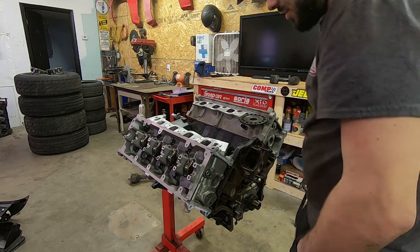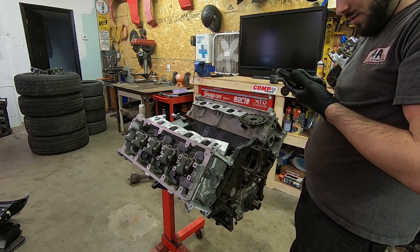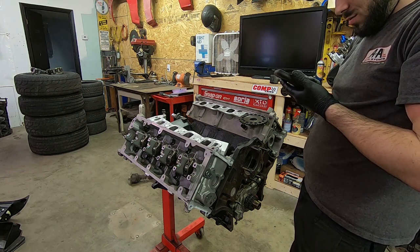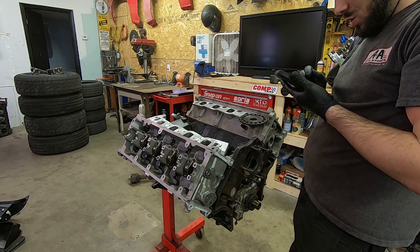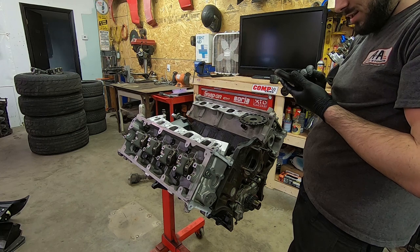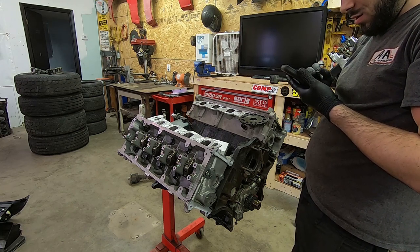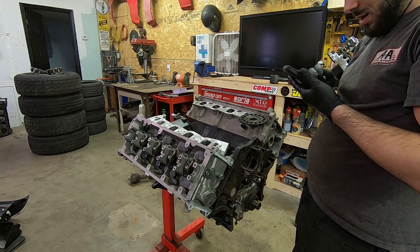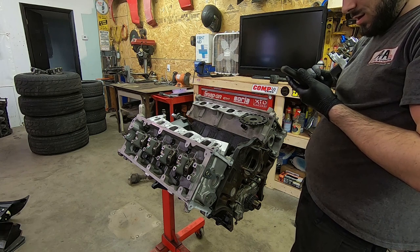I'm going to have to look at his email now. Keep all the pistons safely under the deck to avoid any possible piston or valve interference during installation. With the keyway at 9, you can spin the cams. The correct keyway slot is marked and will correspond to the right side cam gear. The corresponding crank gear teeth that will get the dark line on the timing chains are both marked in red marker as well. For the top, simply use the OE timing dot on the cam sprockets.